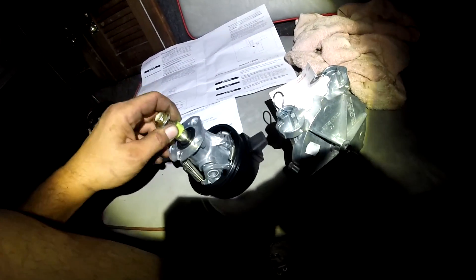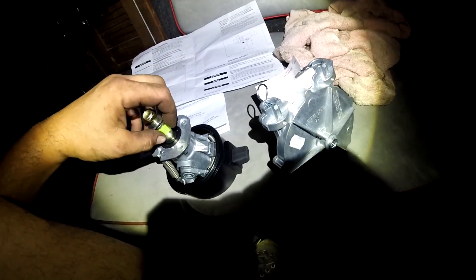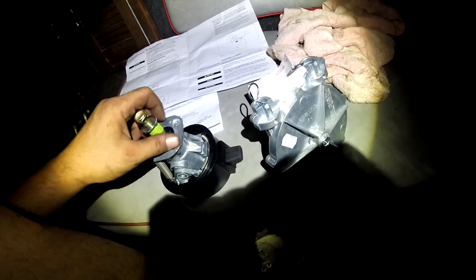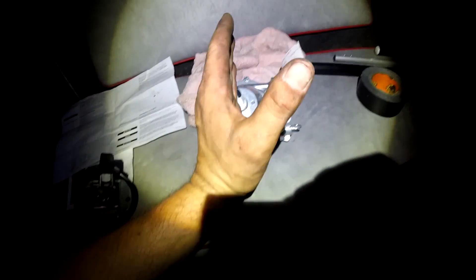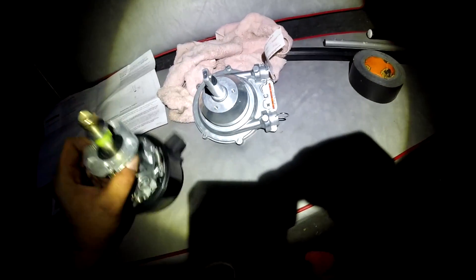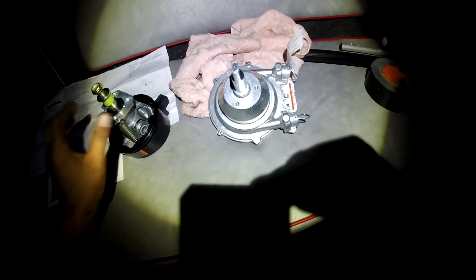The tilt mechanism has a keyway. Being as I don't have the hub in the steering wheel yet, I've got a 50/50 chance of it being right at the top or the bottom — I don't know until I get it. This thing the way it's made can be upside down or right-side up because of the way it connects. I mounted this and centered it so I can have it one way or the other and still be right. I'm going to try to feed the wire into this and get it all mounted together.